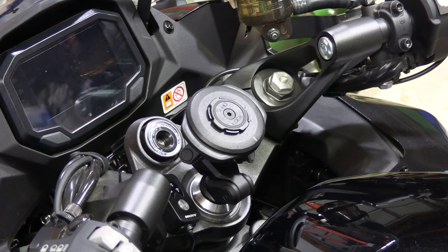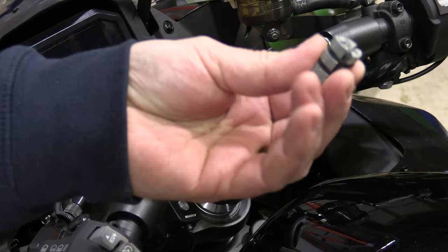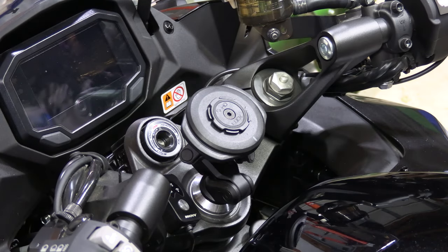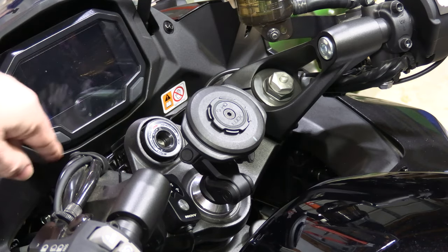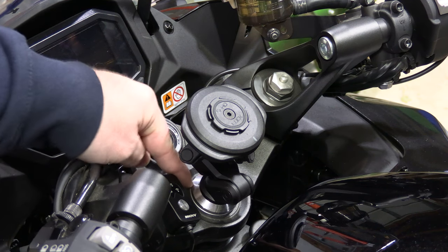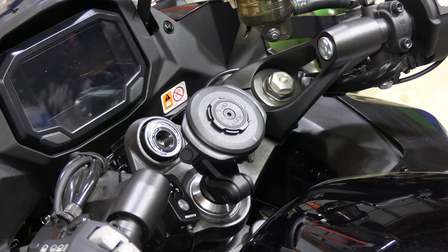If you want to securely mount the standard stem mount, you're going to want to take the big clamps and your nut. What I did was I actually glued them together with super glue — just little dabs. And you're going to feed them up from the bottom of your stem tube with a hose or something, anything to lift it up there and try and align it in the middle. Then you'll run the bolt down, hopefully hit it without breaking the glue loose and losing the nut, and get it threaded in. It is a painstaking process, but it is doable. The problem is every time you need to do something with your steering head bolt and take it off, you're going to be redoing the same process over and over. So I do recommend going with the Pro mount.